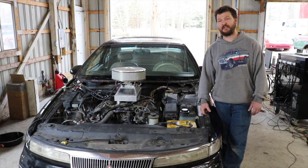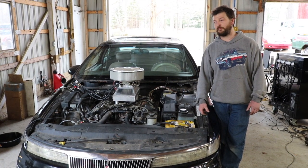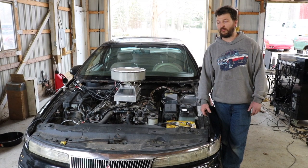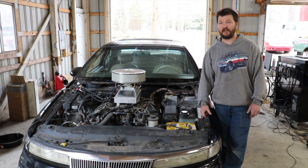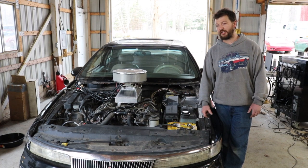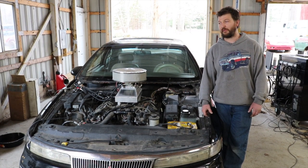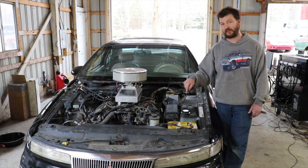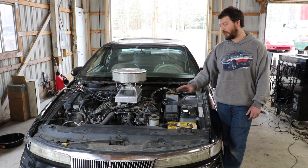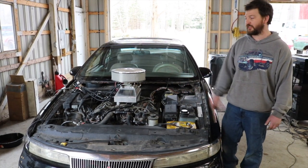It didn't make the power I needed it to make. I'm going to have to run too much boost to run better gas without adjusting the timing. So ultimately it's going away. I'm going to have to go to an MSD Mod 6 ignition. I'm probably going to buy a JW Ultra Bell to go to a Turbo 400 and abandon the AODE, which is what is in this specific car. The other two drivetrains I have are 4R70Ws — I'm going to sell them. This whole drivetrain, we have something else planned for it. You'll see soon.